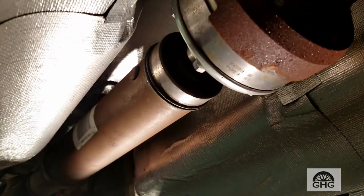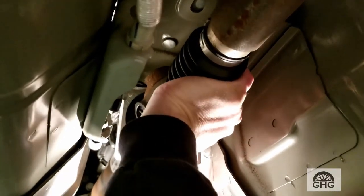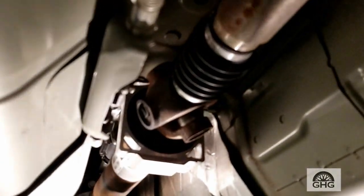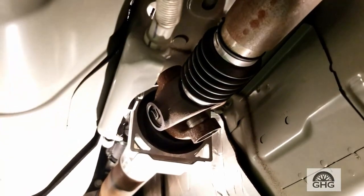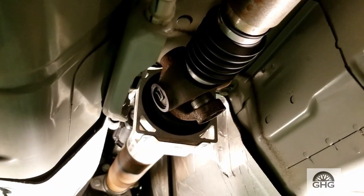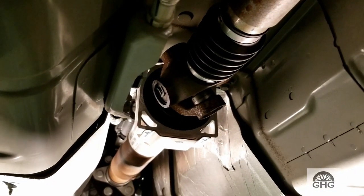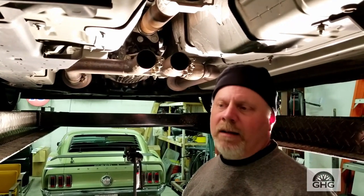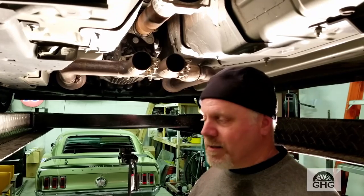You can't beat the old design. See how much slop this has? That's starting to fail. That's a lot of slop — you can see it moving right in the carrier bearing. I've had a vibration starting about 5,000 miles ago, I knew it was coming. Rather than go back to Ford and do the same thing over again, I went to Shaft Masters.